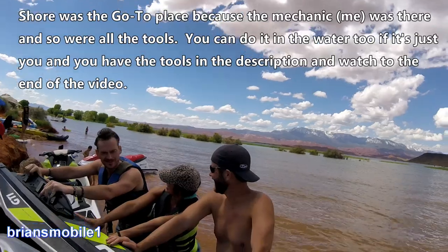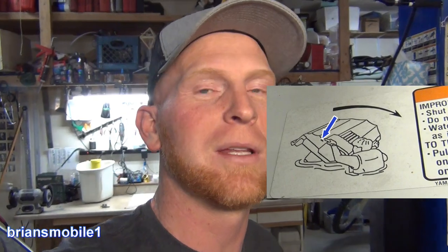The other thing you need to do is get the craft either on its side so you have access to the bottom, or flip it over upside down. Either one will do. If you're out in the middle of the water, obviously you can't hold it sideways — on the shore that's what we did because it was easy. We could prop them up and just balance it. There's not a lot of weight to it. People dump these things over on a consistent basis, so much so that there are instructions on the back: most of them you tip them clockwise, and then tip them right side up clockwise, so water doesn't get into the intake. If you tip it the wrong direction — look at the back, there'll be an arrow. I promise you that. They all have that.